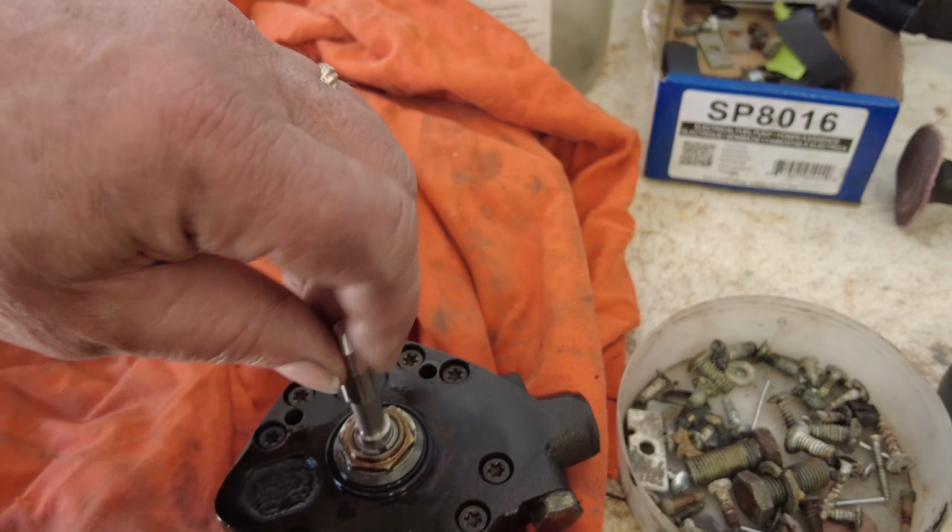Likely no difference, because I think a fuel accumulator would be the answer for everything. Oh, to be wrong on all counts here. So the ball bearing wasn't supposed to be in there, which is the first thing that was jamming. Then when I put it together with that spring in there, it wouldn't allow the bellows to come up. That spring was holding it, making it only go that far and putting way too much tension on that. I think that thing's got to move fairly easily. So it must be flow pressure that keeps the pin down, or gravity, right? Gravity and flow pressure keep the pin down, and then this thing lifts up and allows fuel to go. So I'll just put it back together the way it was, and I'm pretty sure that's the way it has to be. Anyway, that's all I know for now.